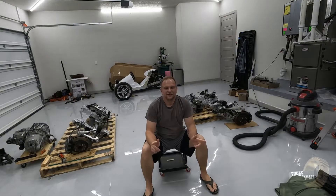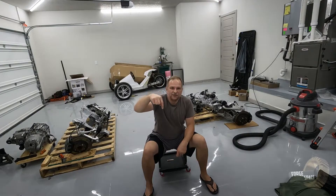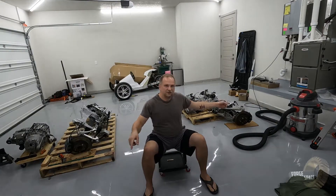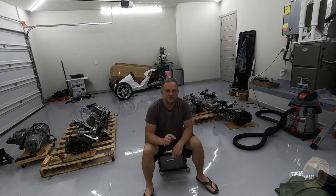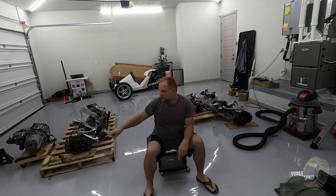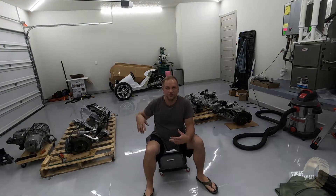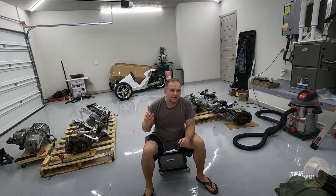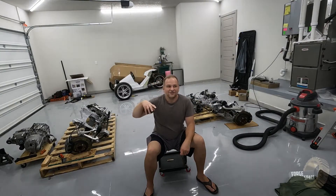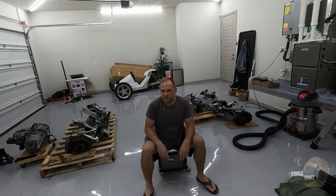That's going to be it. We went ahead and got the inverters shipped off to be reprogrammed with InGenX — link below for their website. DDR Motorsports, link below, built this kit car around C5 suspension. This is suspension from a C5 Corvette — we're basically using the A-arms front and rear, the spindles, and the hubs on those are already drive hubs. We just replace the hubs with drive hubs and we'll be set up for all-wheel drive with our new motors.